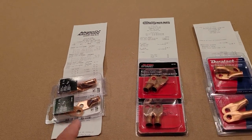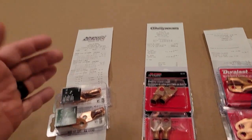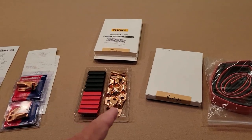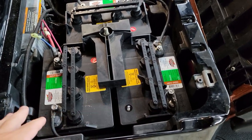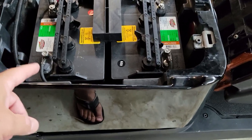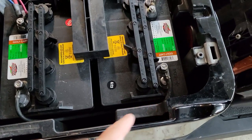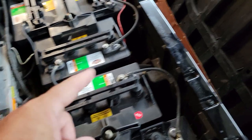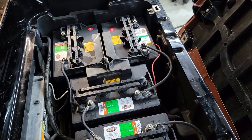It makes sense if you're just going to do one terminal — most people don't need as many as what we're doing, so go to your local store, that's perfectly fine. But if you're planning on making upgraded battery cables like this video is going to show you, definitely go online. As you remove your old battery cables, make sure you label them so you know which one goes where when you replace them with new ones. Label them cable one, two, three, four — however you want — just make sure you put them back in the same order.